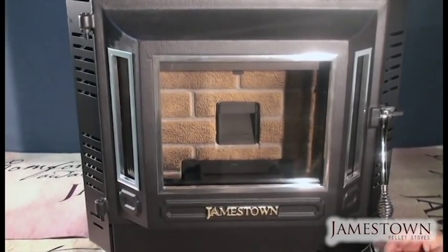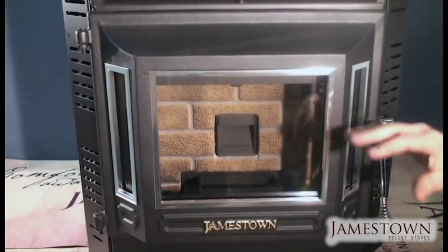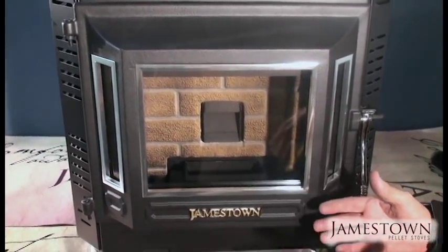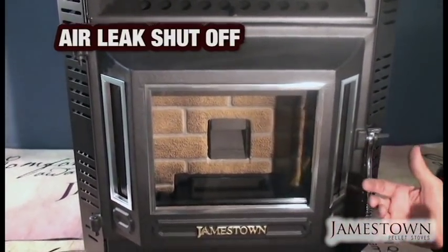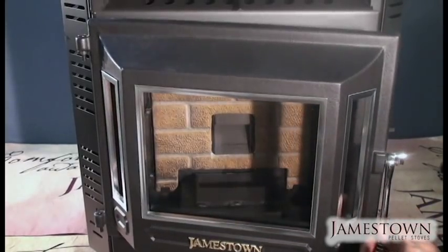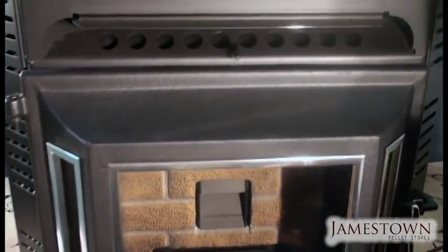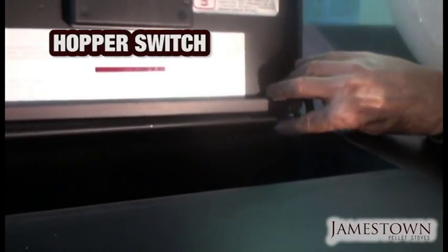There's an important safety feature: if a door opens, there's a large vacuum leak, or there's a change in pressure inside — because the stove runs on negative pressure — a sensor inside detects it and automatically shuts the auger off, cutting the fuel supply. The stove will go out, and the control board will flash indicators telling you what to do. If you open this door and leave it open, within about 30 seconds the auger is going to shut off.